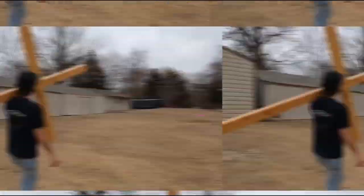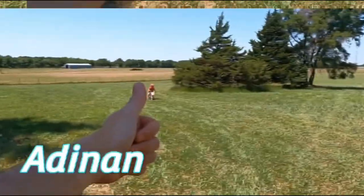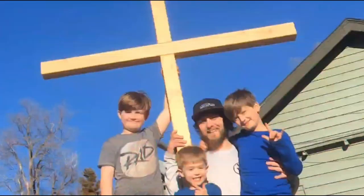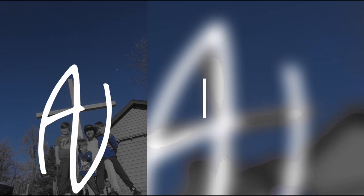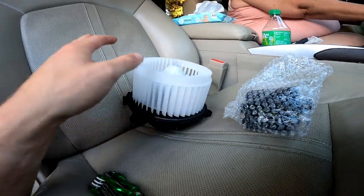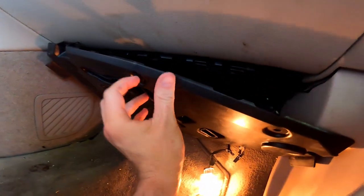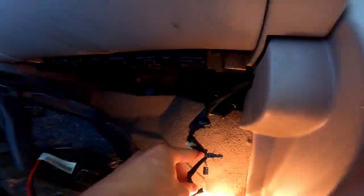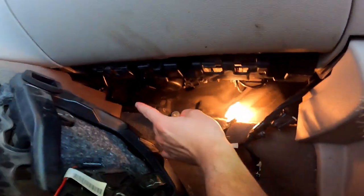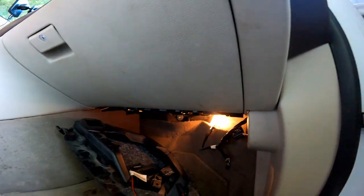Check out the other video if you need it. For our parts, this is the blower motor and this is the new resistor. So far all I've done is pop these little body pins out — there is one on the back that connects there. I pulled that out, took the light out, and I'm gonna use it down here so I can see while we're looking up there.